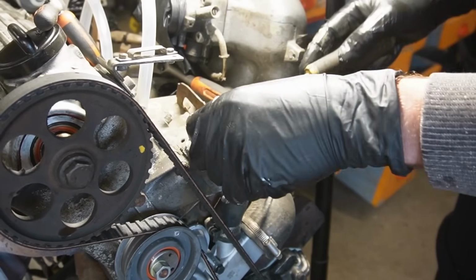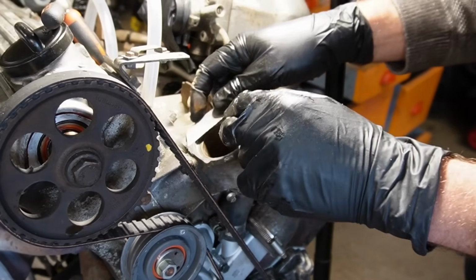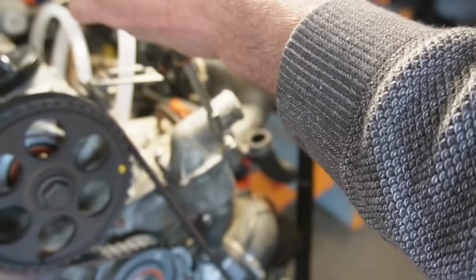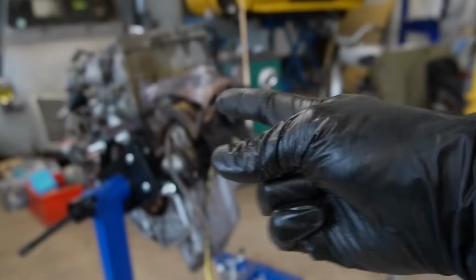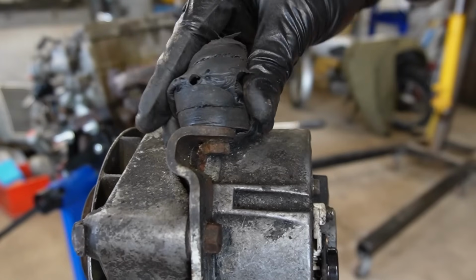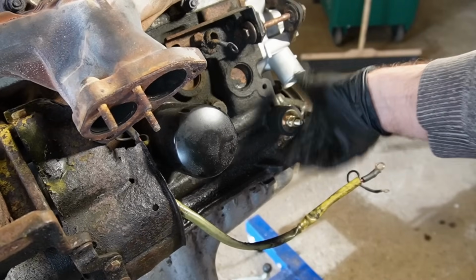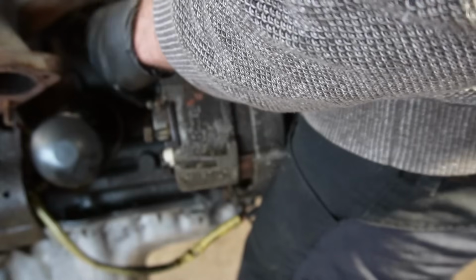And from this point in the video and going forward, I forgot to turn on my microphone, but I changed that thermostat, and then I went to the local shops, and lucky for me, I actually was able to find that bushing I needed for the alternator right there. Not the correct one, but it's the same size. I had to cut the threads down a little bit, but it did fit pretty nicely. So I got that in and reattached the alternator, and now it was possible to adjust it.